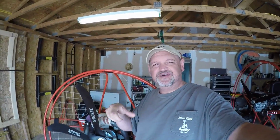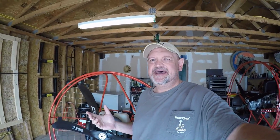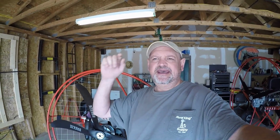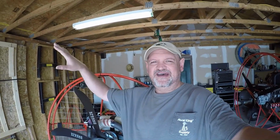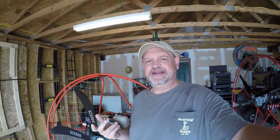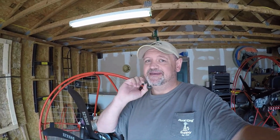I just want to give you kind of an intro on this video you're getting ready to watch. What had happened is I got a hold of Chris at Southern Skies, and he said that it seemed like the motor was running a little bit rich. So he suggested I take out the 160 jet in the carburetor and put in a 155, which I did. What you're about to see is a couple takeoffs, couple landings. I took off with the 155, seemed to have more power, but it was spitting and sputtering quite a bit. So I barely made it back to land, changed that jet back into the 160, took off again, and buddy, I'm telling you, it was terrible. Almost didn't make it back to my landing zone.